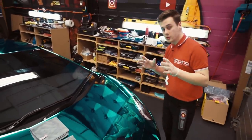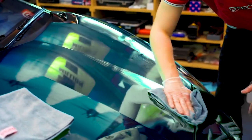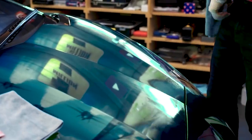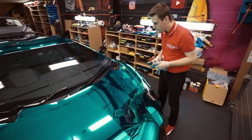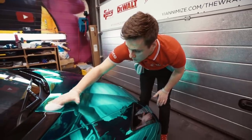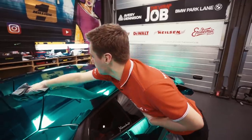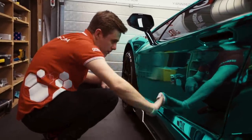For removal we're going to be using two cloths — you can really feel the resulting slickness coming into play. This is the finished product, but nobody can buy it yet, so this is the first car on the planet that this product has been on. For maximum performance we recommend two layers of Halo. You need about an hour in between coats for the first coating to pre-cure, so by the time you go around the entire vehicle and come back to the first panel, that should be around the right period of time.